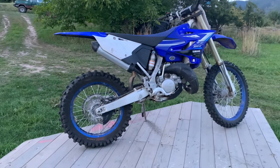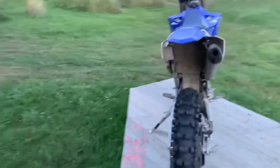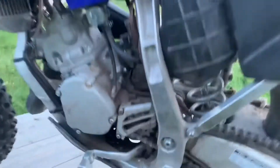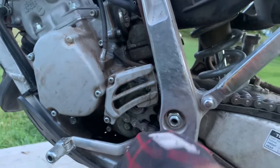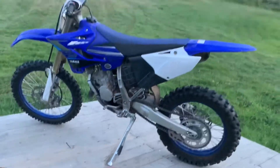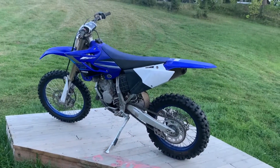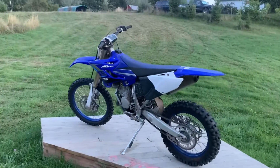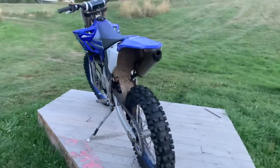Other than that I'm quite happy with it. A little bit of suspension tweaking, and I did a 12-tooth sprocket on it from the 13. I just put that in recently but so far I really like it — it gives it just a little bit more bottom-end grunt for getting over those really big logs and at the top of the really steep climbs where these little 125s seem to start to run out of steam. Thanks for watching!